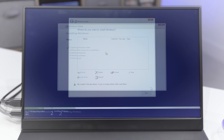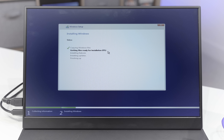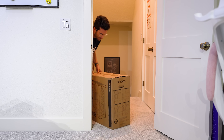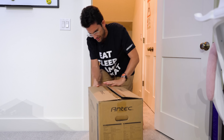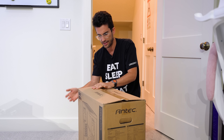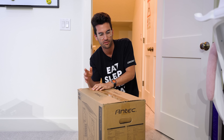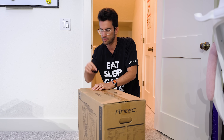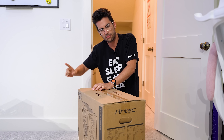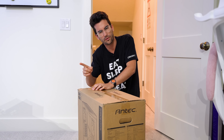We've managed to get it up and running here. And I'm hoping we don't run into any other problems, because it's like nine o'clock at night. I started working on this build like at 10 in the morning. While that's setting up, we'll go ahead and unpack just a random extra case I have laying around — this is actually from Antec — and it has a USB-C port on the outside. So we have a cable we can plug directly into that motherboard to see if it's the case cable to blame or the motherboard port.